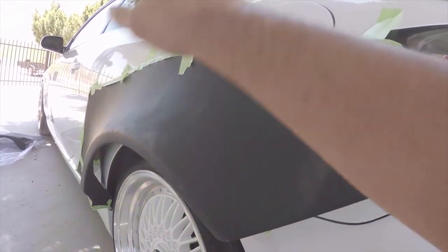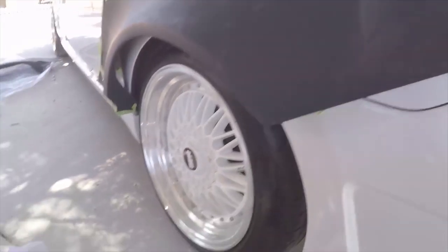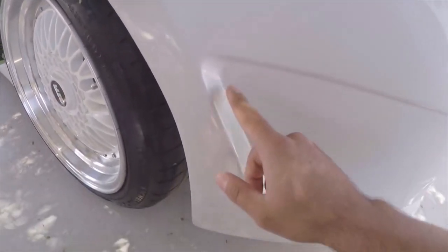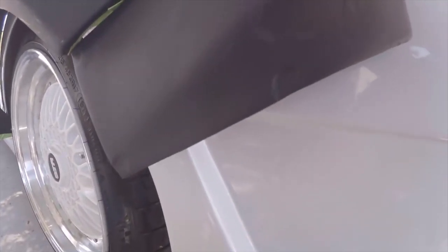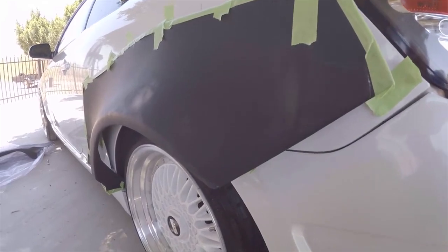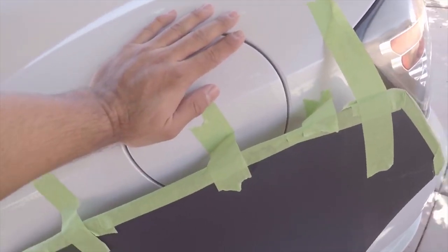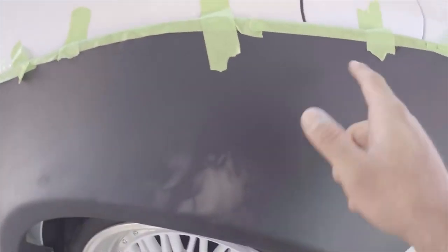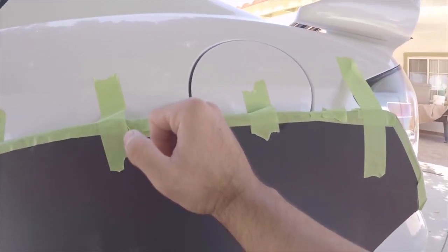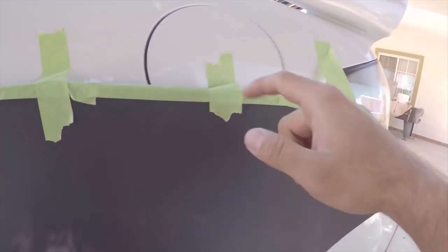Once everything fits perfectly flush, I'm thinking of cutting all the way through following the body line, and doing the same with the piece that goes near the bumper groove — it's going to overlap there. That's the left side. Moving to the right side — I also should mention the fuel cap. The left flare doesn't have a fuel cap door, the right one does because the FRS has it on the right. We'll probably just remove the fuel cap and cut along the groove — it's not as bad as I expected, less than half a circle.